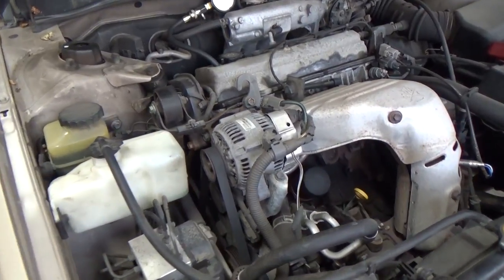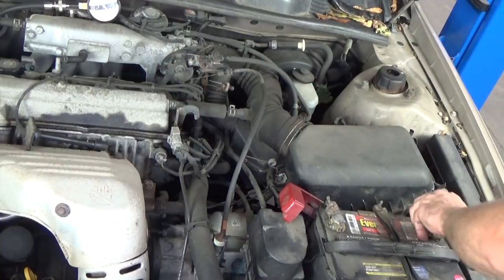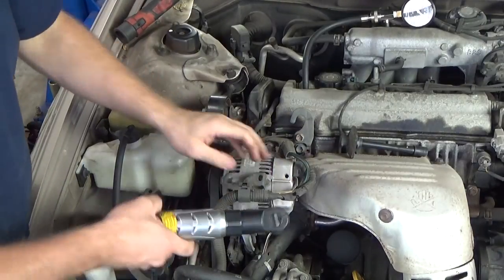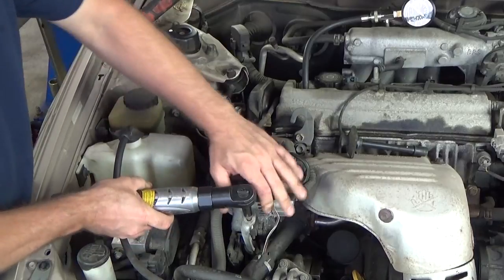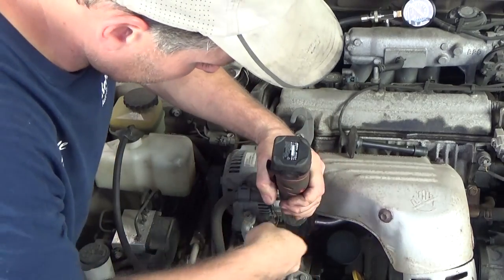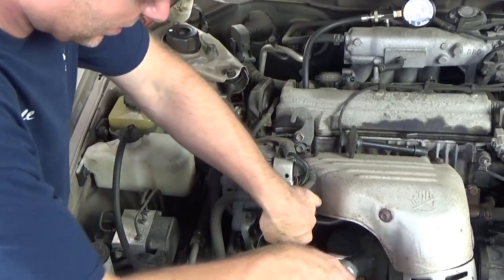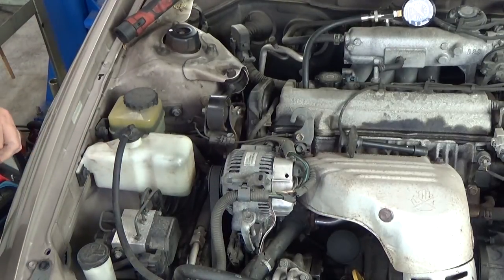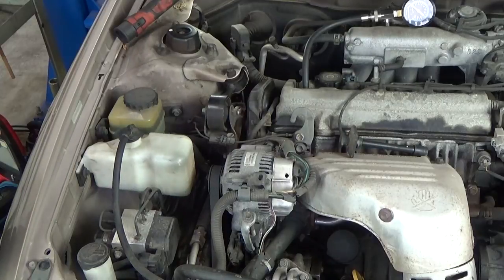This timing belt does drive many things. First thing you want to do is actually disconnect the battery — 12mm. I'm just loosening up the tensioner on the alternator. We are going to be pulling this alternator completely off. I loosened it up to relieve the pressure, and then I just removed the retaining bolt completely. I might move this coolant reservoir hose too, just to get that out of our way.